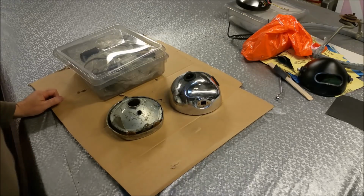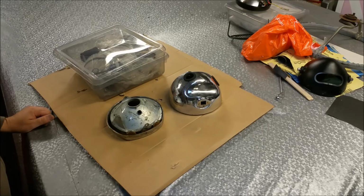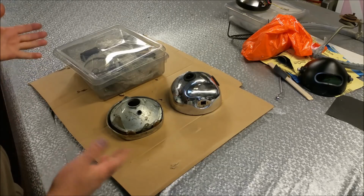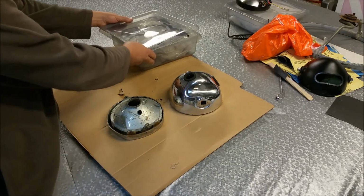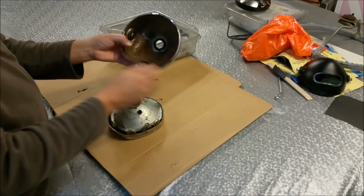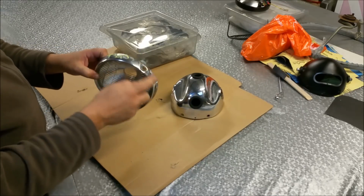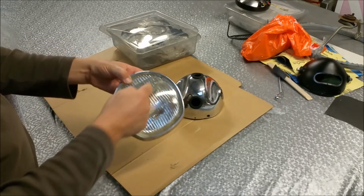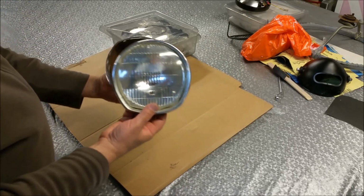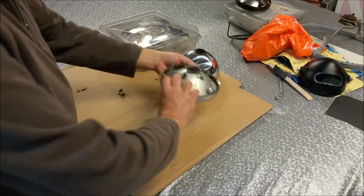Right, there's a couple of parts on this bike which are sort of iconic to it. One's the headlight. The other is the twin leading shoe front drum, which I don't have. But we've got the new disc brake rim and all that sort of stuff, and I've gone with that, though I'd sooner have the original drum brake one. But anyway, look, we've got a lovely headlight bucket here. That's the flat bottom type. And I actually found a second headlight ring, which is in good condition. It says T250. But of course we've got this crack here. Now I think that's worth repairing. Waiting for the right replacement to come along and repair that.